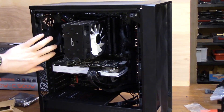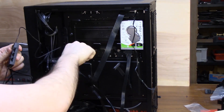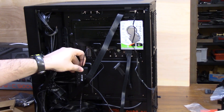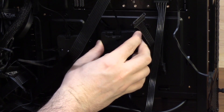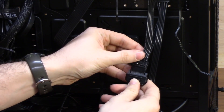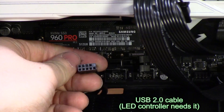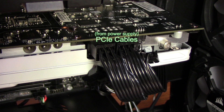The last thing you might need to install is any peripheral — I need an LED controller for my fans. There are many different types so I can't cover all of them, but to power them you'll probably need either a SATA power cable or a Molex connector. If you have multiple hard drives using up your SATA connectors, you might need to plug in an additional SATA cable from the power supply. Each SATA power cable has three connectors on it — I had exactly three SATA-powered things, so it worked out perfectly. Note that the USB 2.0 cable looks similar to the HD audio cable but has a different pinout, so you won't accidentally plug it into the wrong connector.